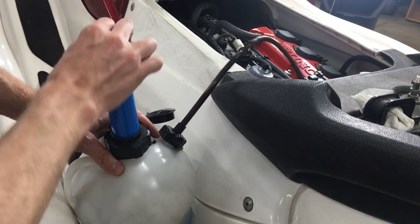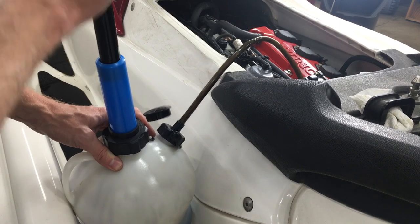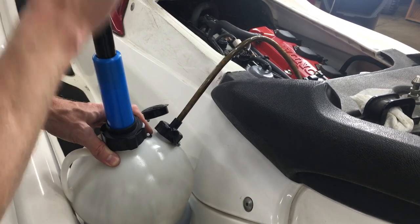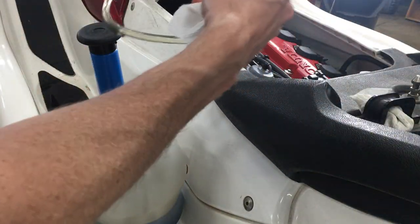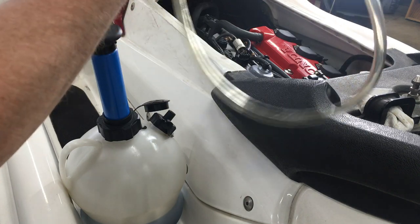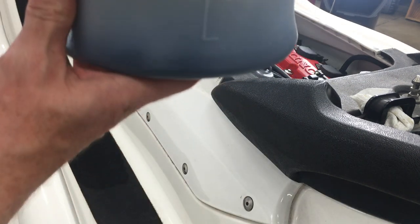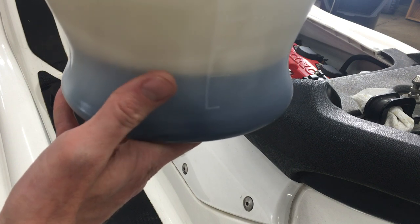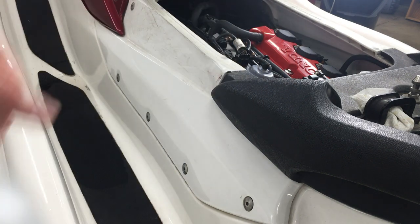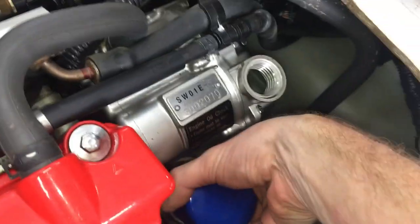I'm at the milkshake stage now — I'll see if I can turn the hose down any farther, getting every last bit of used oil out of the rear. It's good to wipe things down right away to prevent any oil drips. It looks like I got almost an additional liter of oil, and that's on top of the 4 liters I already emptied out. Don't forget to put the cap back on the rear. Now I'll change the oil filter.